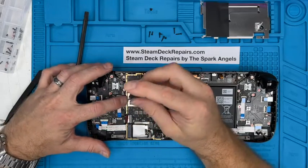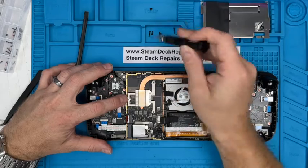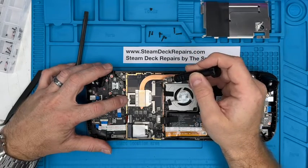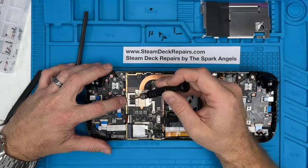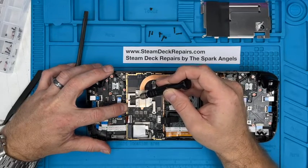So you're going to take the heatsink screws out here. You've got the 2 large head Phillips, black Phillips screws that go in there. Obviously that one comes out with the shell. We take that one out, and this silver one actually stays in place. It can't come out. It's got a little heat plate in there.